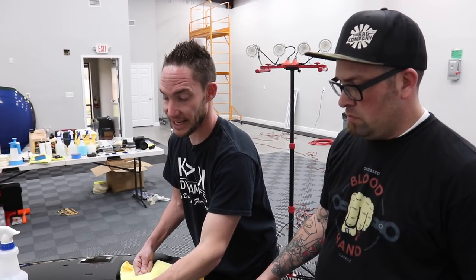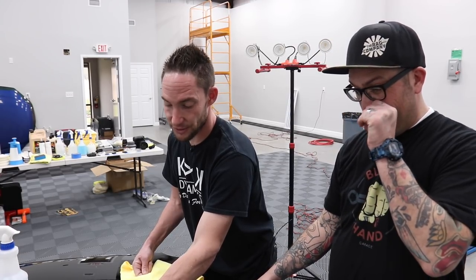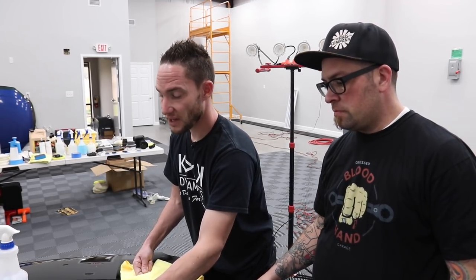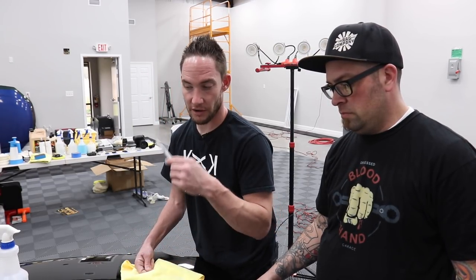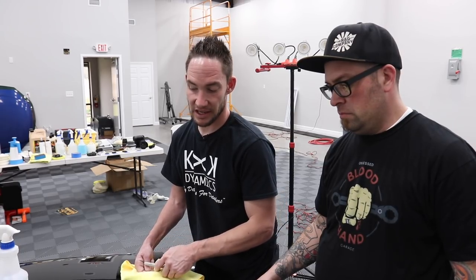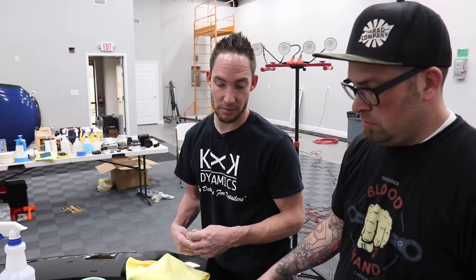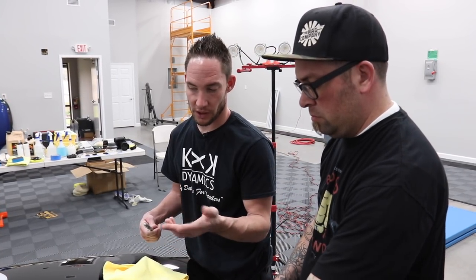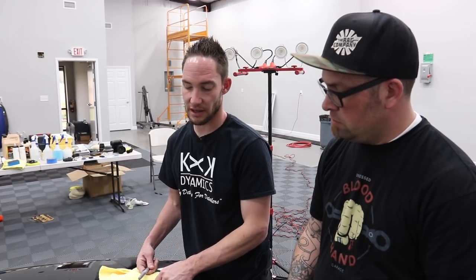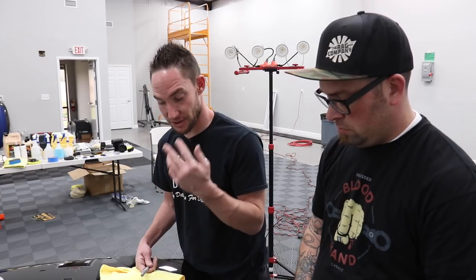So hence the gauge. OEM is where it really is beneficial because you have less clear, and you have an idea, depending on the car, that some cars have more paint than others, and you can find that information. So there's enough information out there, but to sand and polish an aftermarket spray, whether it's custom or a collision shop, it's really hard to tell by gauge what you have. Your final gauge is your eyes.